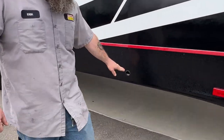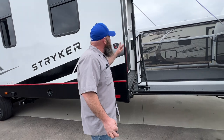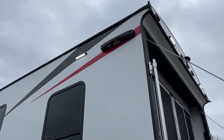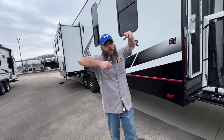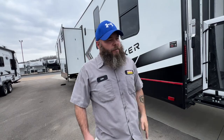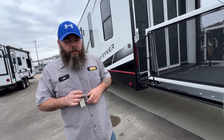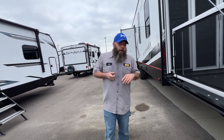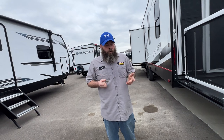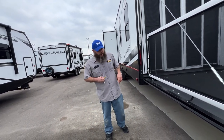This is so you can lower your spare tire if you need to change it. Next we've got the on-the-go ladder mount — it's a telescoping ladder you can purchase with two hooks. It telescopes down so you can get up and inspect the roof. You always want to try to inspect the roof every 90 to 120 days, making sure no air bubbles have formed in your lap sealant or the roof sealant, or any cracking that can occur over time. When that happens, clean it up and put some new lap sealant over the top.